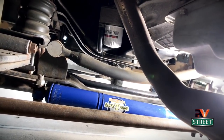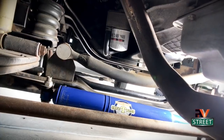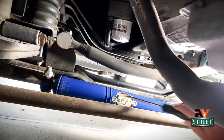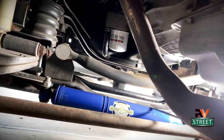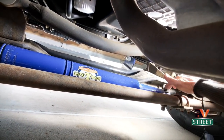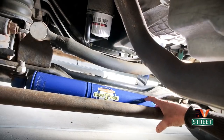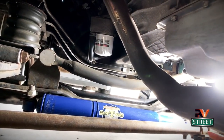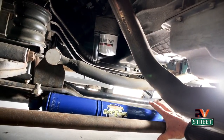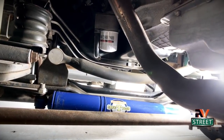Here we are under the coach, right behind the front axle — you have to get access from the back, right behind the front tires. This right here is basically a stabilizer with a spring inside this casing. It's mounted over here on a bracket with one bolt, and mounted with another bracket with one bolt and two U-bolts. It's a really easy install. What the Safe T Plus does is basically two things: the front wheel is going back and forth in wind or when an 18-wheeler comes by, and the stabilizer stabilizes the steering, making handling and driving a lot easier.